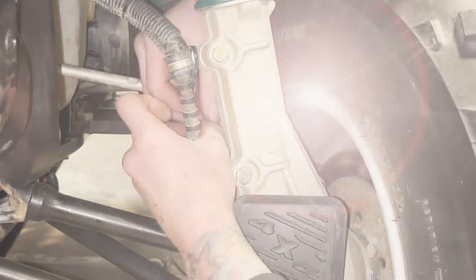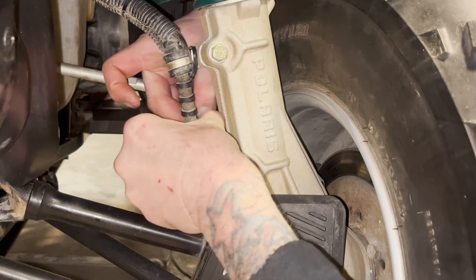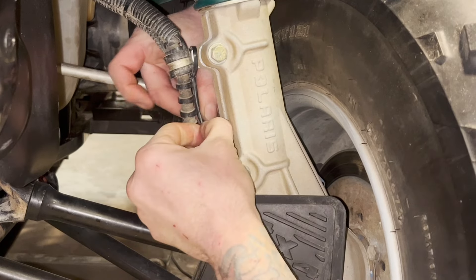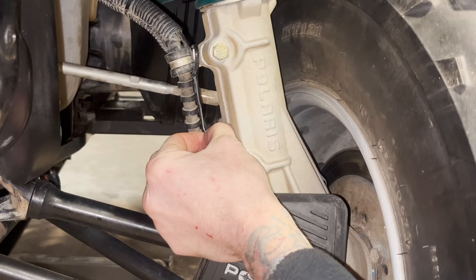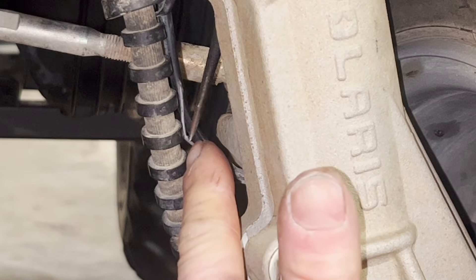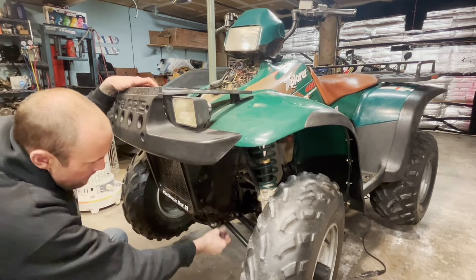I got no action here — what's the deal? You want to make sure you have power and ground. You want to make sure that you have power on the gray wire, not the red wire. It could be very easily confused here because you have a gray and a red. I'm used to automotive stuff where red would typically be your power. So ideally you'd want to use some wire strippers to peel this back a little bit. I didn't have any at home, so I took my test light. You don't have to start the vehicle to do this — just put the key on, put your all-wheel drive on, and try to make good contact on the gray wire. I was able to just pierce through it, and before I checked for ground, I noticed I didn't have any power — my test light was not lighting up nice and bright. So before we check for ground, let's just assume it has a good ground.